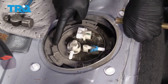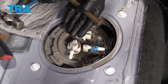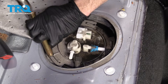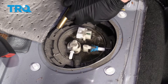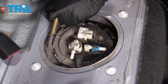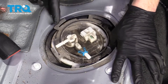Next, we're going to move along to the lock ring. To remove the lock ring, you want to use something as basic as a brass punch. You don't want to use metal because we're going to put it right up against this and bonk it with our hammer. Something you need to pay special attention to is the fact that if you do happen to make a spark, this is fuel and it's going to go poof. So let's avoid that by using a brass punch. It's starting to turn — just keep on rolling with it.